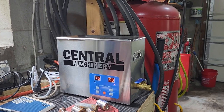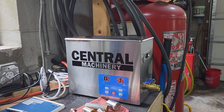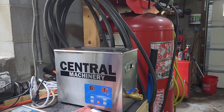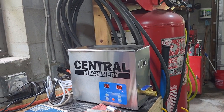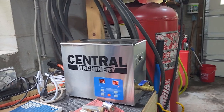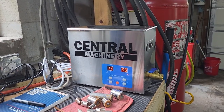What I do is different — for carburetors as an example: I did a weed eater carburetor that I needed to clean. I put it in a glass jar similar to a mason jar, put gasoline inside the mason jar, and just put the mason jar inside the ultrasonic cleaner. It came out perfect.